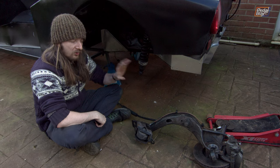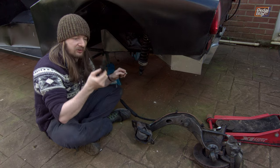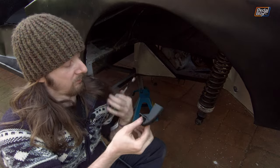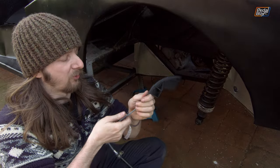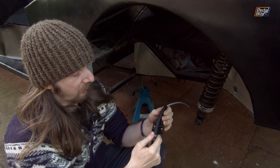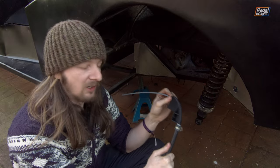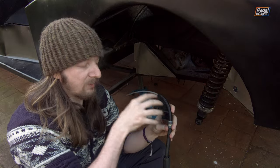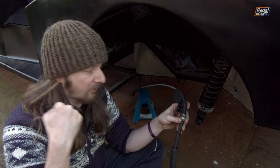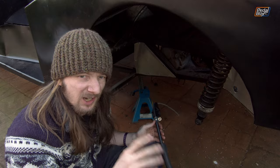Now the coilovers are in, we've got something to support the rear end of these heavy trailing arms. But before fitting those, I'm going to jog your memory on how these handbrake cable protector-redirector things work. You can already see the kink in our handbrake cable Bowden where it was wrapped around that corner of the body into the transmission tunnel. Fitting this piece creates a much smoother radius and the whole Bowden is supported all the way around, distributing the friction that was previously concentrated on one tiny corner. That should make our handbrake easier to operate and add some lifetime to it.